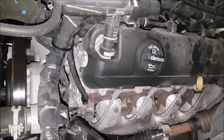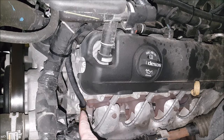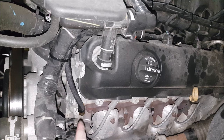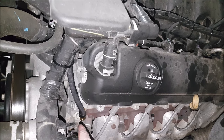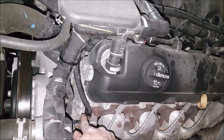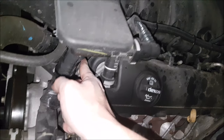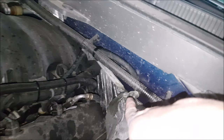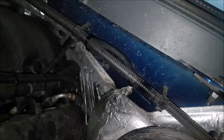What we've done for the driver's side is we have the side post adapter. I'm not sure if a lot of you know — on a lot of V8s, even Fords, the thread pitch is actually the same as a GM side post. So I grab these copper adapters and feed it into a hole that's not a thread being used, and I run it up here. You see our tape matches the factory tape. Then I come back to a factory grounding point, which is shared with the motor, but now the cab is sharing it too. So we're tying the engine, the battery, and the cab a lot better together.